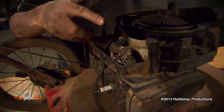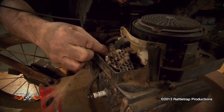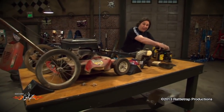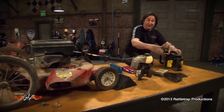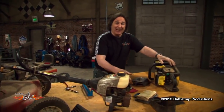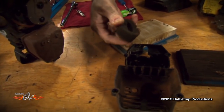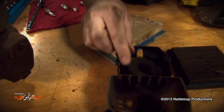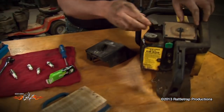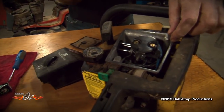While you're replacing the plug, it's also a good time to check the plug wire and the coil connections. If they're bad or worn, replace them. Another thing worth addressing is the air filter. Due to the nature of what these things do, it's always dirty. If you have a foam filter, clean it as you would normally and replace it if it's starting to get brittle and fall apart. If your paper element is bad, just replace it. If you neglect to do this or try to run the engine without an air cleaner, you're going to tear it up pretty quickly.